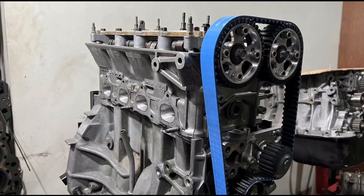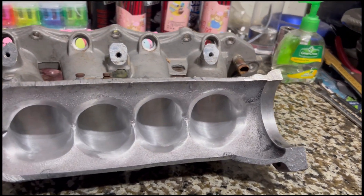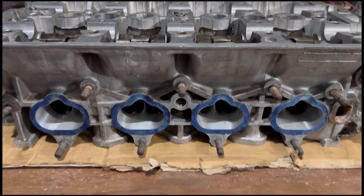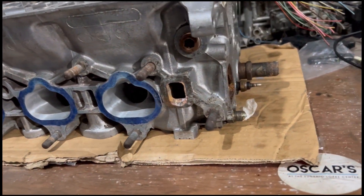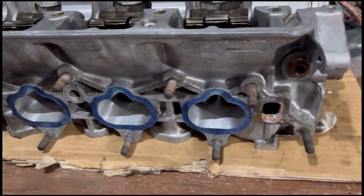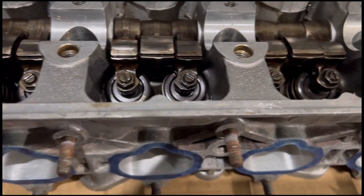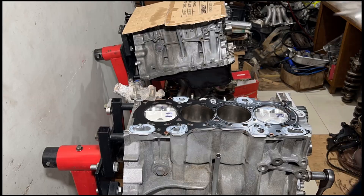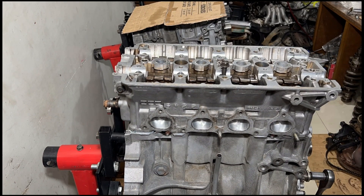On this B20 VTEC episode it's almost done — the intake manifold is going to be ready to be welded, and the head is fully assembled. We removed the checking spring as we degreed prior. It has an old school style VTEC line, and we're going to correct that. Here is the Crower valve train for the Crower 403 cam, which is going to be perfect. We're going to slap the head on the block and finish this engine today.